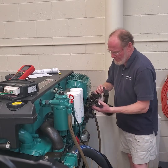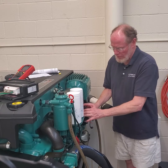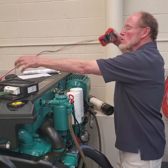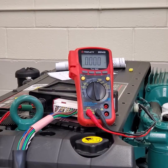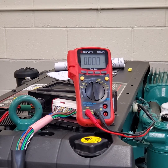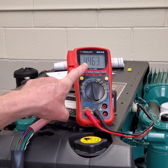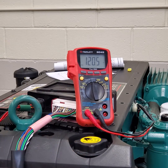Now that I have that plugged in, I can check for the actual cycling frequency of that circuit. I have the m-prop plugged in with the breakout box and the multimeter set on frequency. I'm going to turn the key on — give it about a second or two. We have 2.55 Hz and then it goes up to about 120 hertz as it cycles.